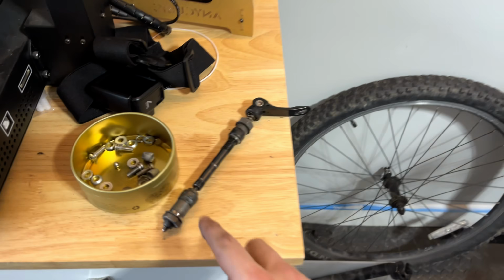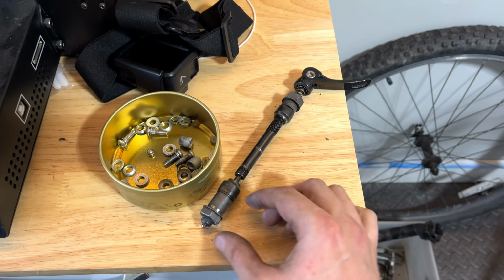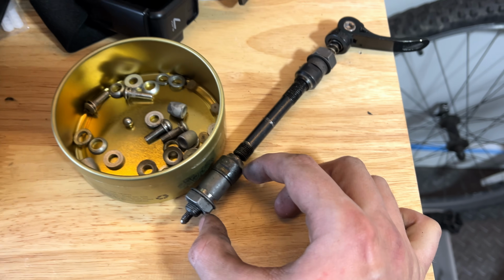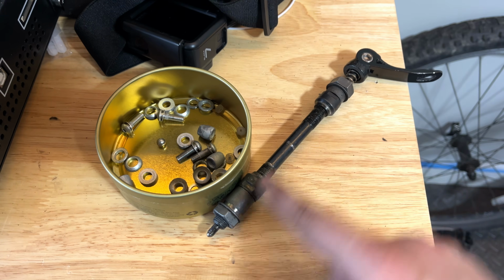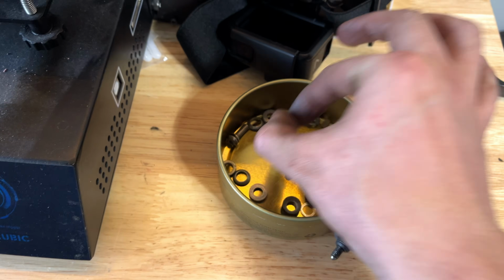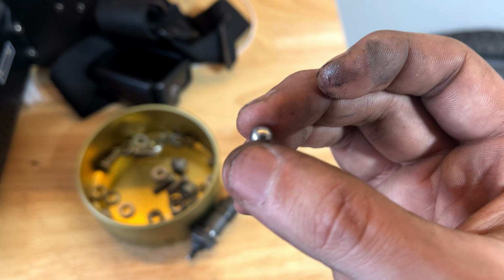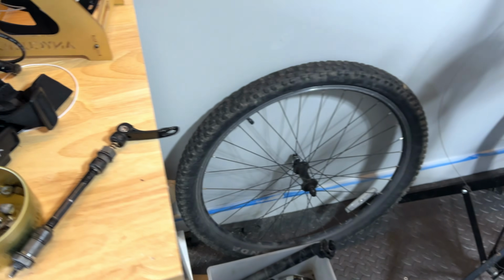Of course, I've got to try and source one of these hubs. The spindle should be all right, but the actual hub, as you can see there, is snapped on the wheel. So at least we have a reference one to go off, but I'm just going to see how much it would be to replace that. I've got no idea how they've actually snapped that hub. Luckily, there were a few bearings left in the race, so I can measure these, and again, I can just order those on eBay, so it shouldn't be too expensive. Everything else looks to be okay.